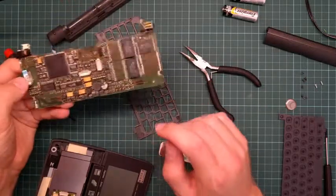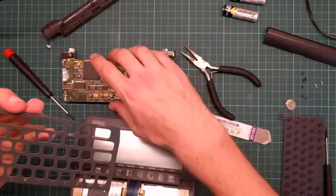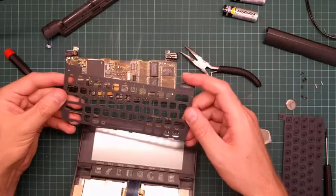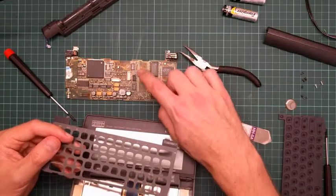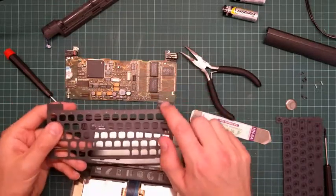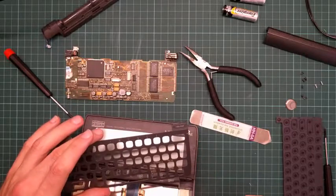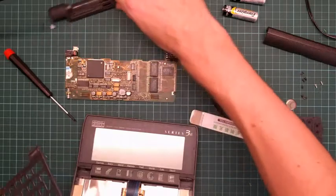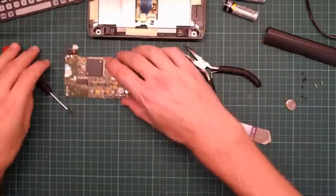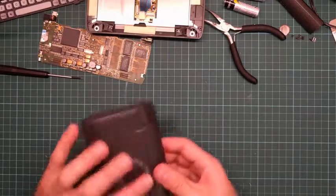I think I've just solved my problem. I don't need to disassemble any more than this. All I need to do is replace the mainboard. I can swap the mainboards and swap the keyboard skins - because these have the all-important one megabyte RAM label - and I don't need to touch anything else. So let's put all these things aside and tackle the other one, our donor. We do all the same things.